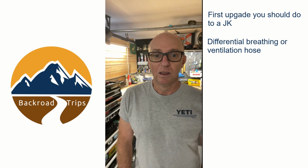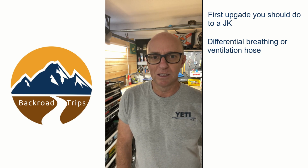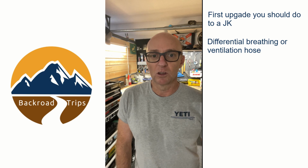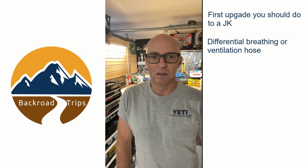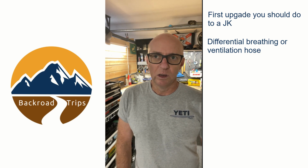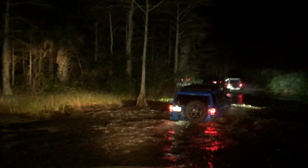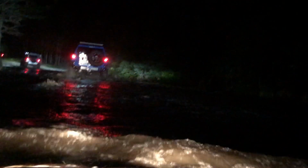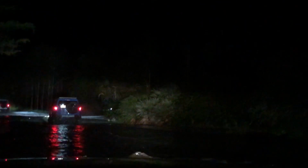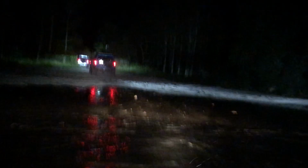The experts will probably be able to put some comments on here and provide more information on exactly what that little end piece entails, but it is just clamped on the top of the chassis or your frame. Now that height is probably 3/4 of the height of your tire. What happens is when you go through a relatively deep water crossing or puddle of water, and the water is higher than that end of the breathing hose, you have a good chance of water being sucked into the differential.